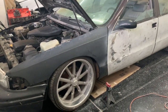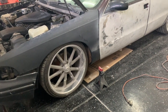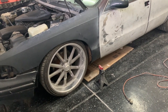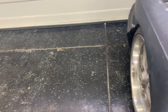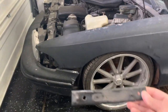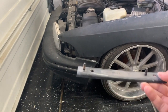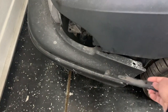I'm going to go ahead and put this car up on the jack stand, take the wheel off, and then start rolling the fenders and see what it does. Also, before we get started, another result of this car getting wrecked was this little piece — if you've ever taken your bumper off, this goes inside the bumper underneath and that's how you connect the bumper to the fender.